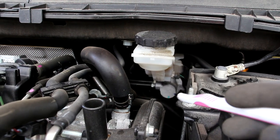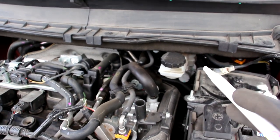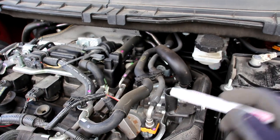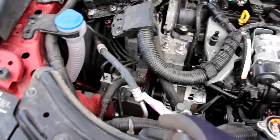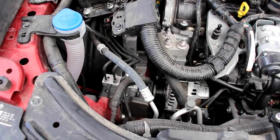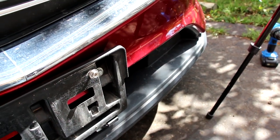The braking setup on the CX-9 is pretty traditional — master cylinder and reservoir here, and just behind it a traditional vacuum booster. However, since this is a turbocharged engine, the intake doesn't have enough vacuum to drive the booster, so a vacuum pump is used instead, also driven off the exhaust camshaft just like the direct injection pump. The master cylinder lines run along the firewall, and interestingly Mazda has placed the ABS module up at the front behind the passenger-side headlight rather than at the rear where it's safer. This module controls traction control, stability control, and autonomous safety features. The Mazda logo at the front — nearly the size of a hand — houses the radar sensor, which is well-positioned up high rather than down low where it could be impacted.